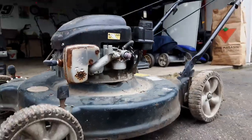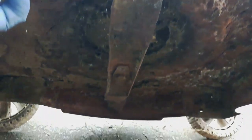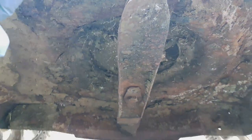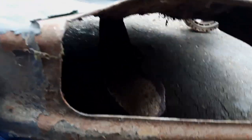Something I wanted you guys to see before I pull the handle — look at that blade. She's curled over, so they obviously hit something. The other side looks okay, so just this one side. It probably had a sudden stoppage, so maybe there's a flywheel key issue on this one. We'll have to see.